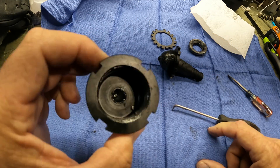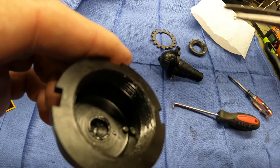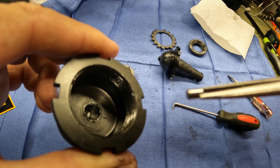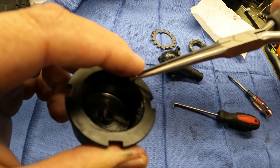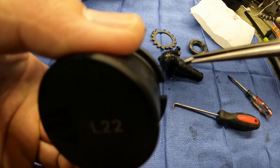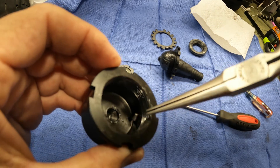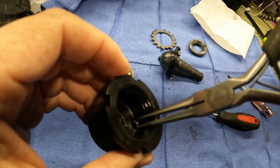The other part is that little pin inside there. This little pin will fall out, so put some grease in there to hold it in place — especially if you're doing this upside down. You don't want that to fall out of place. Put some grease in there to hold it in place. You can see how easy it pops out.